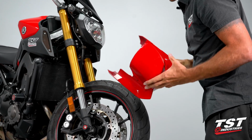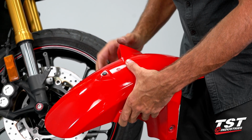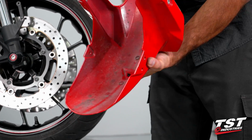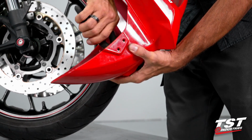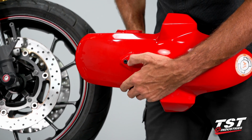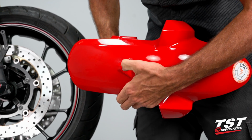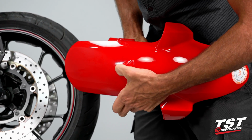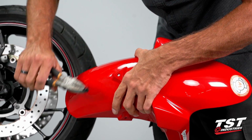All right, so there is a water plug here. On the inside, it has a mushroom head. I'm going to use some pliers to grasp that and jam the fender against myself and pull on the inner portion as I work the outer portion into the hole with my fingernail. And then with some patience, it just comes out undamaged.